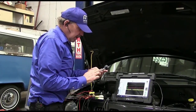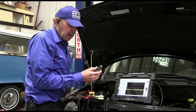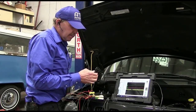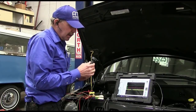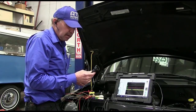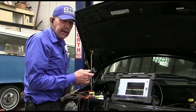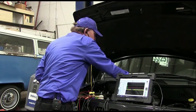Okay guys, this coil here is definitely a new coil, and it looks like an aftermarket one. The shop is telling me that you cannot get coils from the dealer, that there's no OE coils available. When I pulled in, I saw a Chrysler that's got a 6-cylinder in it. I'm going to see if it has the same coils, and I can take them out of that car to put them in here, because I'm not going to be able to get real coils. All I'm going to be able to get is aftermarket. And this is a really unusual problem, so I don't want some weird coil. I want to put a known good coil in the car. So let me go get those coils out of that car, and then we're going to swap these coils out with those.